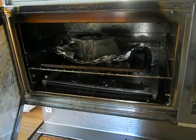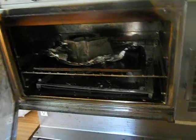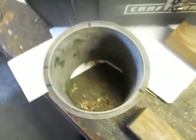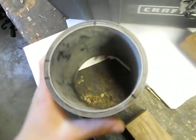Alright, got the cylinder in the oven. Pulling the sleeve out of the freezer here. Now the sleeve's got markings on it — orientation markings that I've used a square and transferred down.